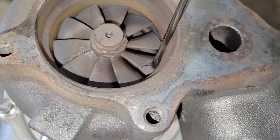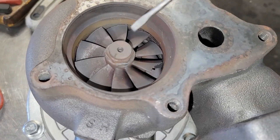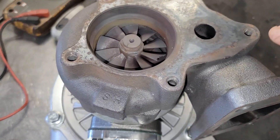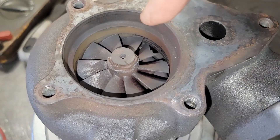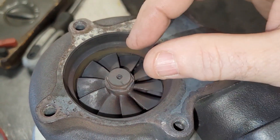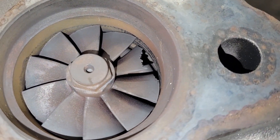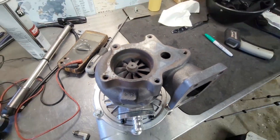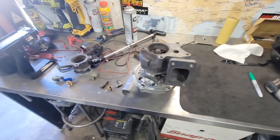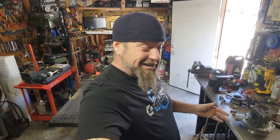See the big chunk missing there — didn't know that could even happen. I've had other issues with wearing the housing, but this one did that. I think the turbine got too hot before the housing did, the turbine touched the housing, and caused a massive blowout. I need to learn from this one because I've had a couple of these with problems so far.